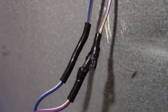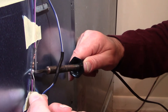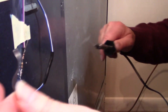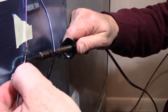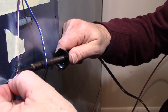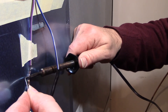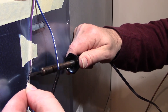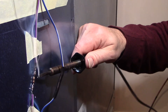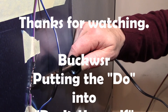That's good news because now we have a clear diagnosis of why I was not getting 12 volts to the evaporator fan motor. I've ordered a resistor — according to Rick this is a quarter-watt, 10-ohm, plus or minus 5% tolerance resistor. I'm not great at soldering but we're going to try to solder a new resistor back into this line. I taped a piece of metal to the back of the fridge to serve as a heat shield. I don't have a lot of soldering experience, so I'm kind of making it up as I go, but I think we got it right.